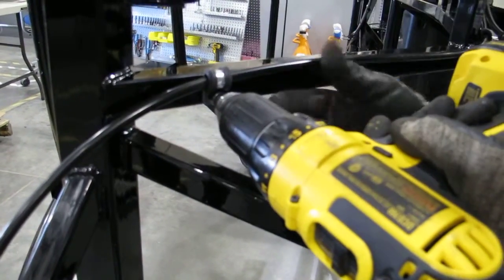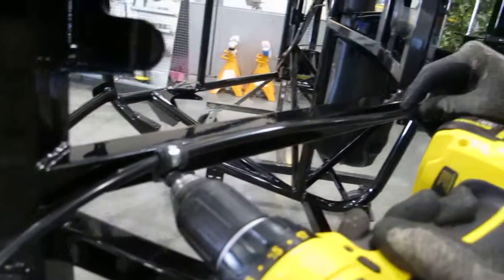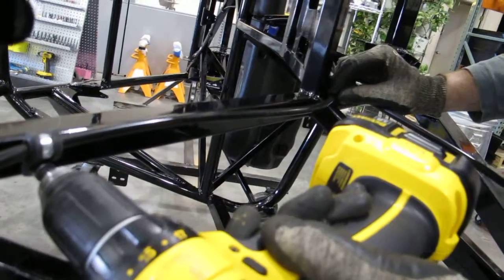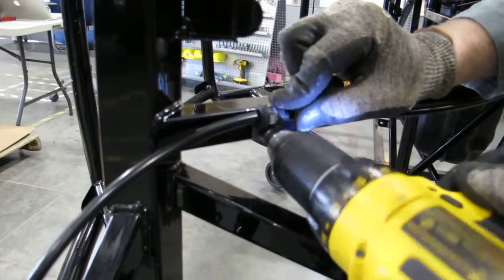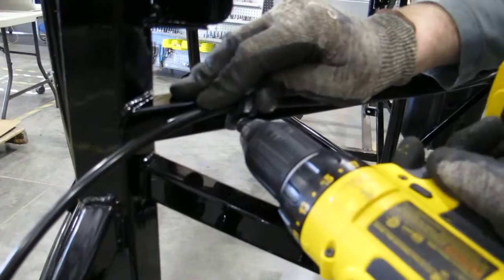I move the clutch back to 11. As a last step, I want to make sure there's enough slack in the fuel evap line so that it doesn't rub against the corner back toward the rear of the vehicle. Once I know it's there, I hold the fuel evap line in the clip in place and put in the final amount.